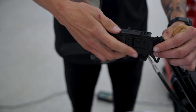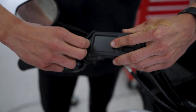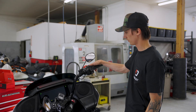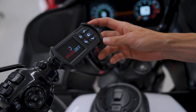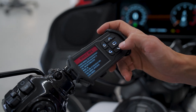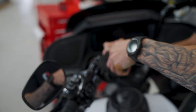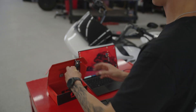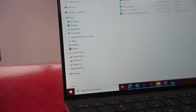Once you've done that, you can do some cable management and route the other end of the cable up to your handlebars, where you can plug it into your PV3 and have it mounted to show real-time gauges and quick access to other tunes. If you'd like to purchase a PV3 mount, that is available on our website and linked in the description. Now go ahead and key on your bike, but don't turn the engine on. Let it walk through the boot-up screen — it has now identified the bike. What we're looking for here is to generate a PVInfo file that snags the ECU serial number and VIN contained on this bike.